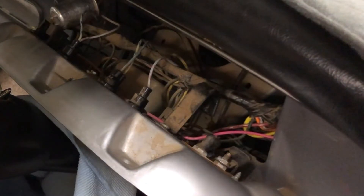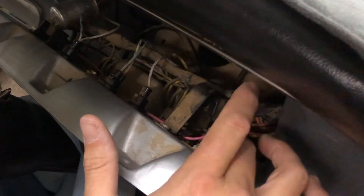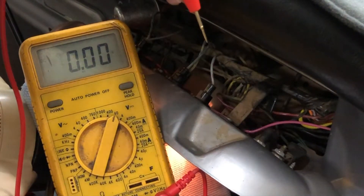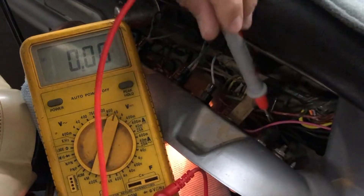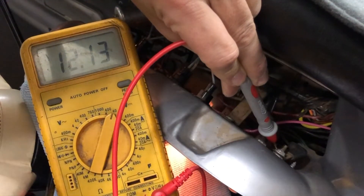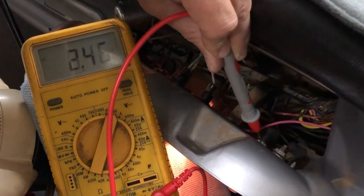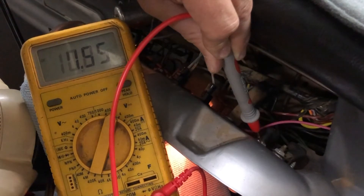As you can see on the right hand side, per my workshop manual, I've got the three-prong temperature gauge — that's the one with the inbuilt voltage regulator. Just to confirm the correct terminals, I've got my multimeter out, hooked up the battery, and switched the instrument cluster on. With the earth on ground: that connector there gives a solid 12 volts, however if I come up to the top terminal of the temperature gauge, the multimeter is actually oscillating between nothing and 12 volts — that's the bi-metallic strip pulsing. That's exactly what we're going to bypass.